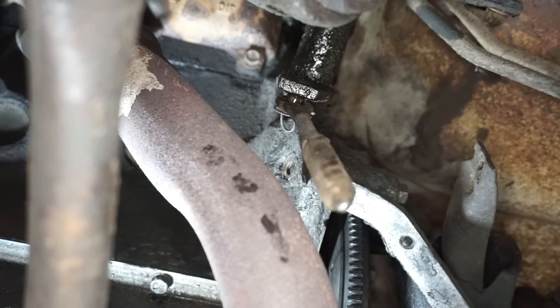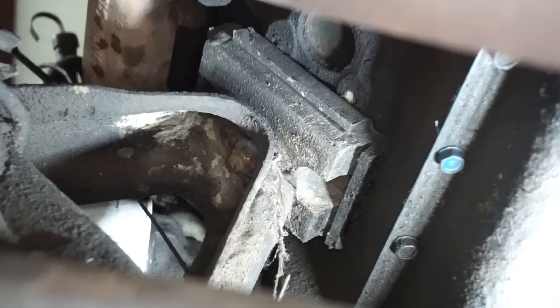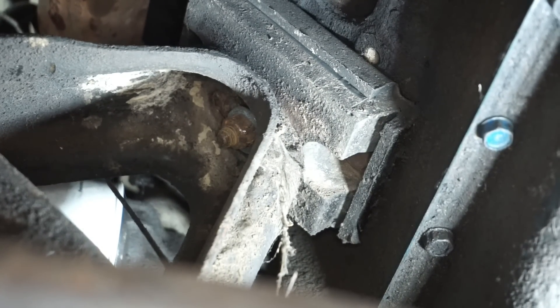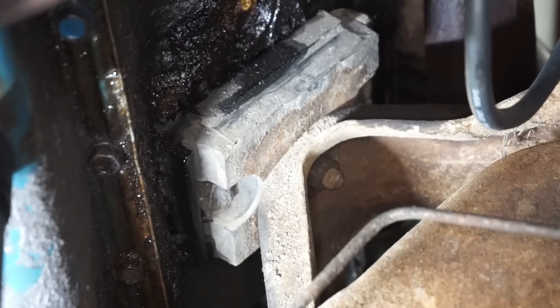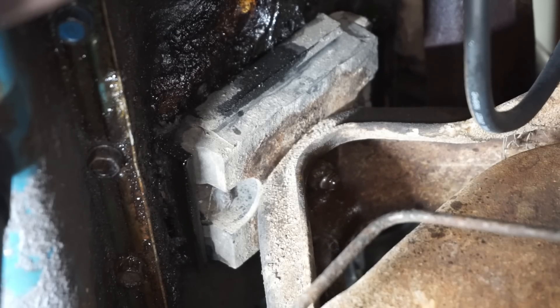The only thing left on the bottom side of the truck is the engine mounts. If you look at the side of the engine, there's the underside of the engine mount standoff. There is a single nut on each side — I'm just going to take that nut off of there, one on each side, and essentially this engine will be ready to lift out. It will no longer be attached to the frame. These are 11/16ths. There's the passenger side — that looks pretty crusty. A little spray on that, and with the short socket this side comes off.